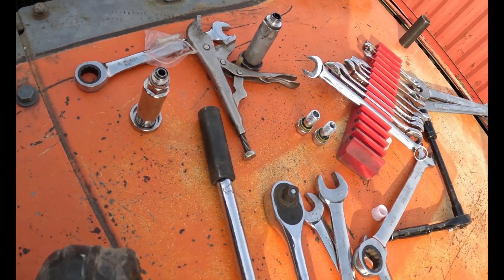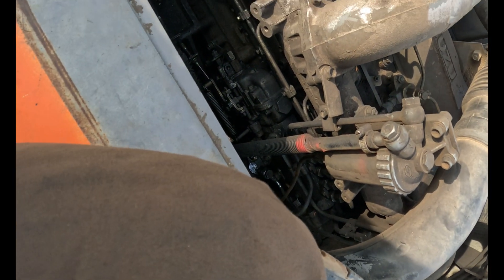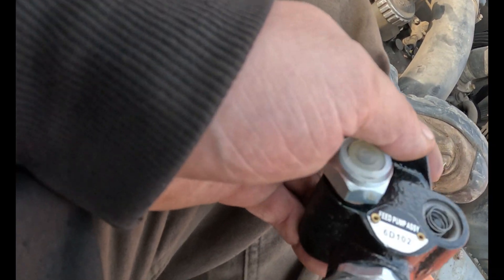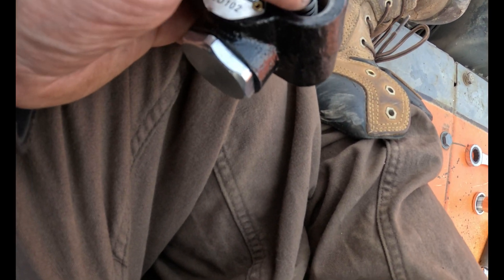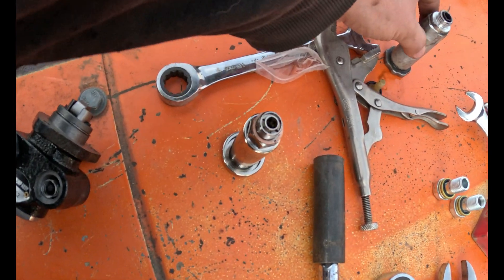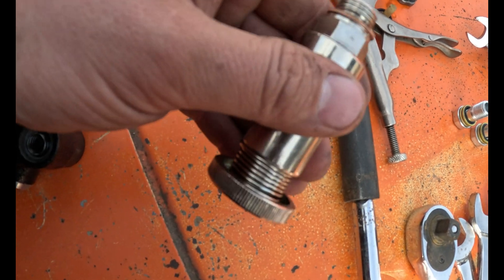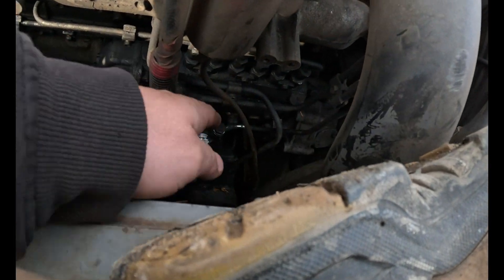So I've got some tools out and I decided not to take the entire pump off. This thing is solid all the way around, so the only things that can really leak are your incoming and outgoing ports and then the face. I realized this thing didn't come with another gasket. Taking it apart, I found that my primer had been leaking — the old one had a rubber sealing washer and this new one has a copper one. I'm going to see if the threads are the same. I still have these banjo fittings in case the inboard or outboard fittings start leaking, but I'm pretty confident it was just leaking out of the top.